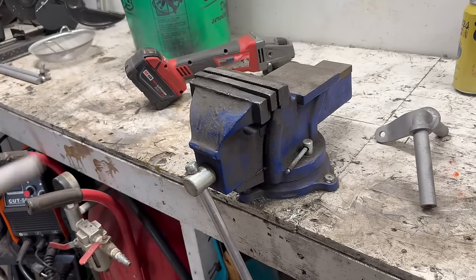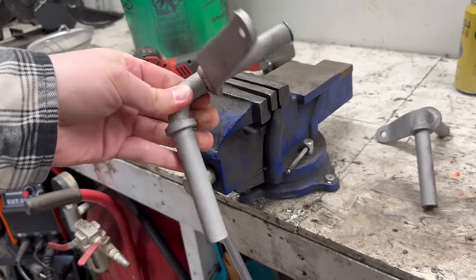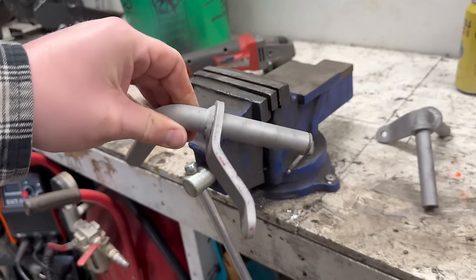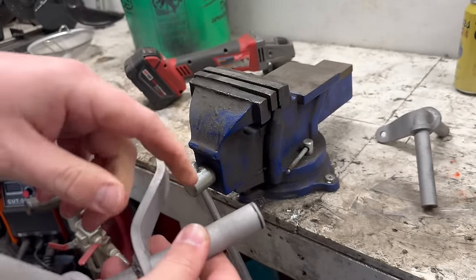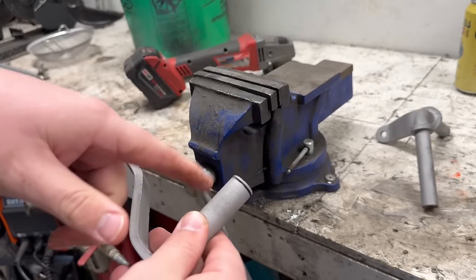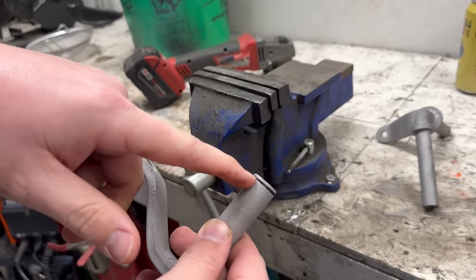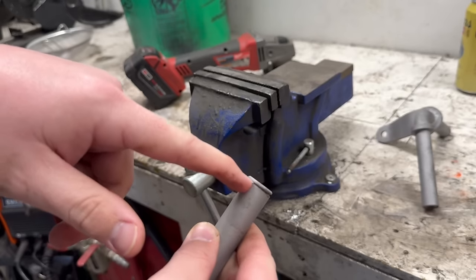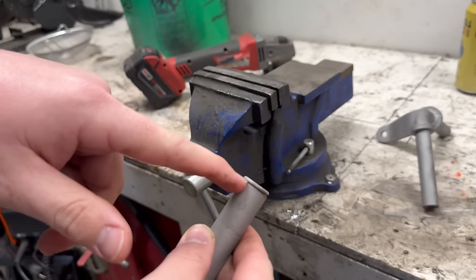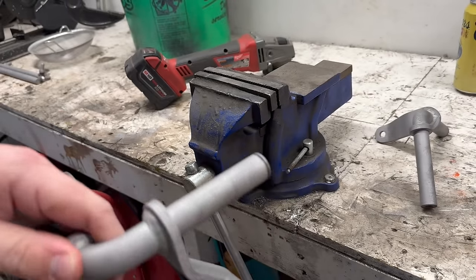Guys, you saw me get these spindles cleaned up. Turned out pretty good. And I've had a few cold snacks by this point. My creative juices are flowing. So instead of trying to source out and locate a new E-clip to replace the ones that I broke, I'm thinking if I take a cutoff wheel, I can just very easily come in here and grind this out, open this gap up a little bit so a snap ring will fit in there and hold it. So that's what we're gonna try.